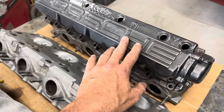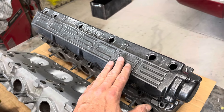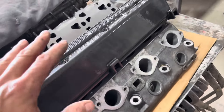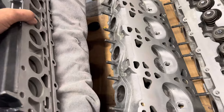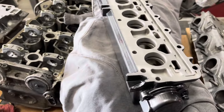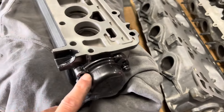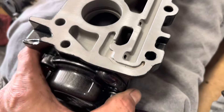Okay, I'm returning. This is a cam tower from my 81 car and the A1 motor. They are a little different than the 79 — these have screw-in plugs, the 79 had rubber plugs, and the lifter valley area is different on this one versus the 79. This has been media blasted — I plastic media blasted this several years ago — and I chose this powder coat color because it seemed kind of cool and it's the color that Allison, the owner of the 79 car, really likes.